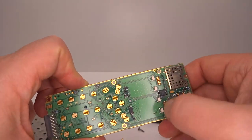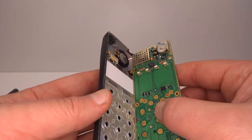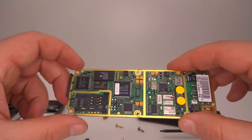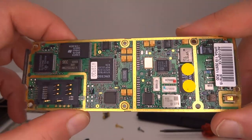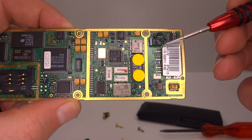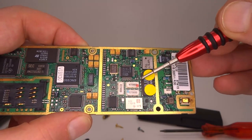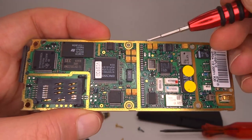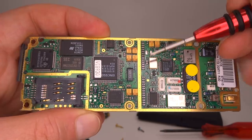Leaving the other side still as the user interface — pretty much the same except the display is not attached. The display simply has a connector to connect up to the front. But let's look at this back side of the board. They somehow managed to consolidate both sides of the GH337 main board into just one side on the GH388. So there's the top with the radio section and the main transmitter. We have this section here which has a lot of the oscillations. There's the Philips chip which I remember from the GH337. Now we have these ceramic capacitors which I don't remember seeing on the GH337 — I'll have to look back.